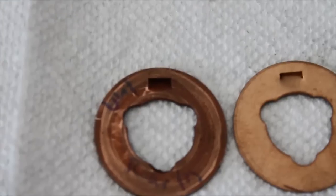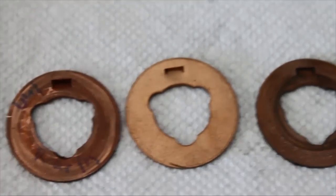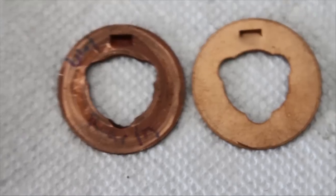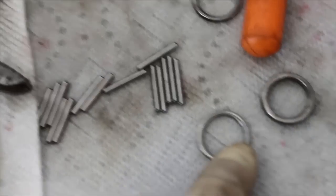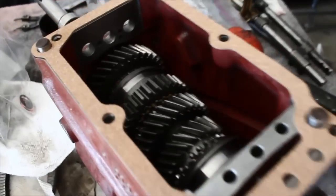Here's a washer that has a little indent in it for oil to travel to the bearings. The one in the middle is the new one, and the ones on the outside are pretty badly scored — they take quite a bit of wear. They cushion the shaft from the transmission on either side. This piece with the oil indent goes in towards the main shaft — it'll pick up a little bit of oil through that gap and send it on its way. We've got 24 roller bearings on that side, all packed with grease, and make sure you've got 24 waiting for the other side as well. Don't forget: a ring goes on the inside and one goes on the outside. The counter shaft and the main shaft are all assembled.